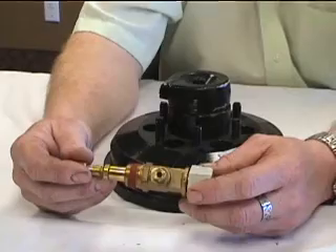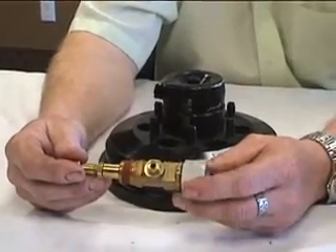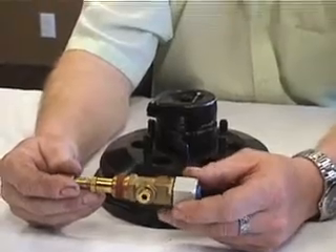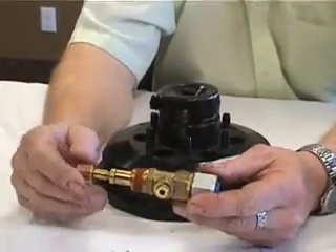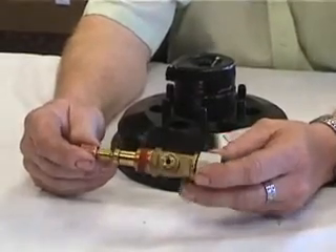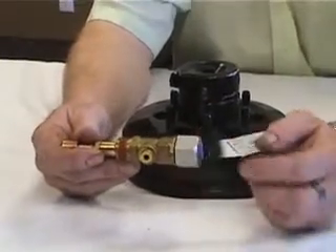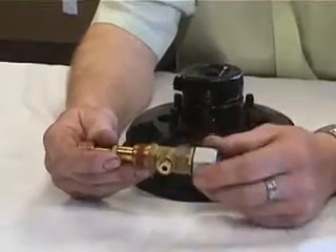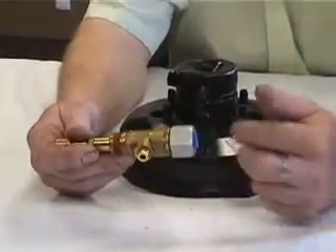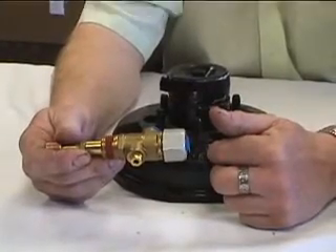The concern that we have is, like anything, if you were to ride the clutch on your transmission — if you were to hold your foot on it a little bit — you'd soon burn it out, you'd throw out the bearing in your clutch. The same applies to a fan clutch. If you only get 60 or 70 pounds of air through your stat or your control, then your lining inside your fan clutch starts to slip and burn.